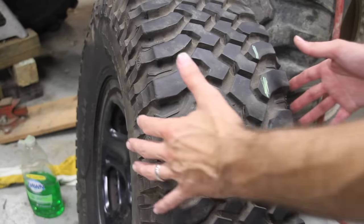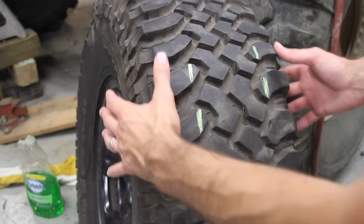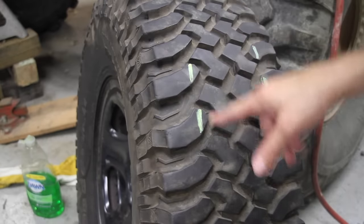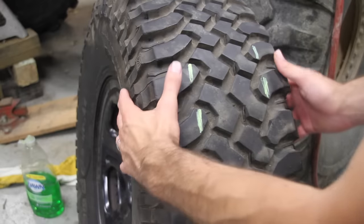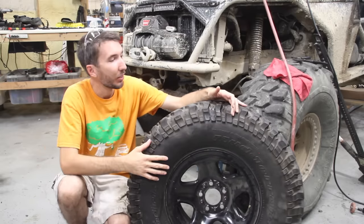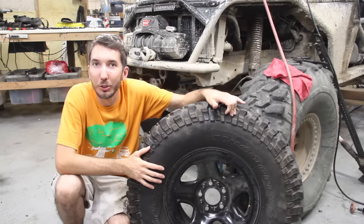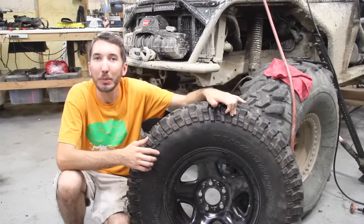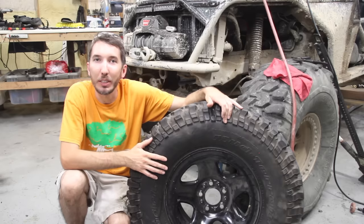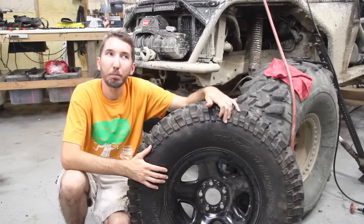The procedure to do a patch is the same no matter where you're doing it, but if you patch anywhere in the sidewall area it's not going to be street legal — you probably don't want to be driving it on the street. A tire shop is only going to be able to patch through the center section. But being able to put a patch on the sidewall would be a life saver if, like me, you don't carry a spare. Thanks for watching — hit the thumbs up and subscribe. Check out our Patreon at patreon.com/bleepinjeep, where we offer our videos in advance — sometimes a week or two before anyone else.